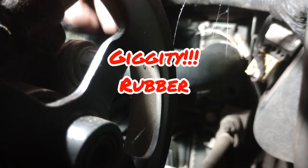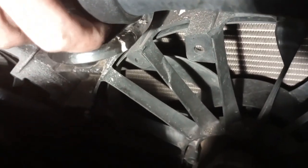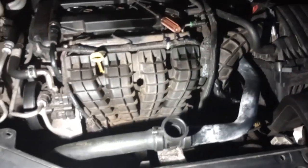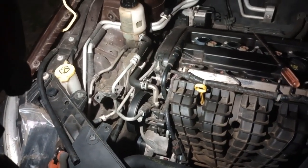Pulling on it and nothing's coming off - the install is solid. Getting that back end on - I did both ends first just so I know it would slip in there good. It should pop - yep, little pop. It's snug now. Like I said, I'm running out of light here, so I'm going to finish the rest of this tomorrow as far as filling it up from the radiator cap. I took the reservoir tank out since we have to replace it.